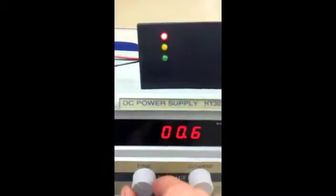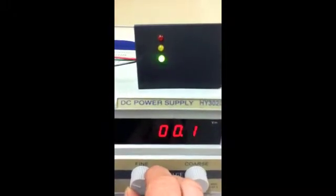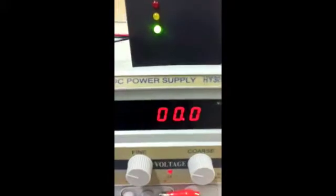So a normal oxygen sensor would cycle below 0.2, above 0.6 or 0.7, and it would go back and forth like this, and we can see the voltage that occurs here. So I just started this car here. You can see the yellow LED is lit. It's not warmed up yet. It's got the bias voltage coming down from the computer to give it a middle volts.